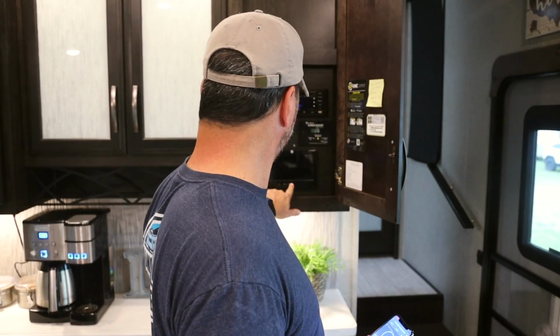If you know your furnace is 7 amps and you think, oh, well, I'll just divide 300 by 7 and I'll know how many hours I can run the furnace. Well, the problem is lots of other stuff is using it. Lights. Right now we're using 23 amps. Let's turn off some lights and see how much those use.